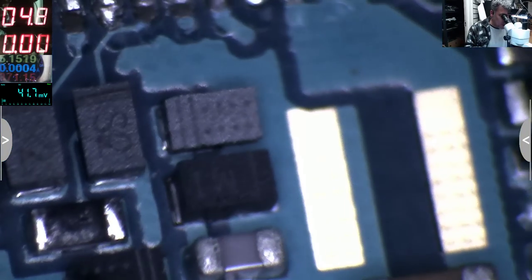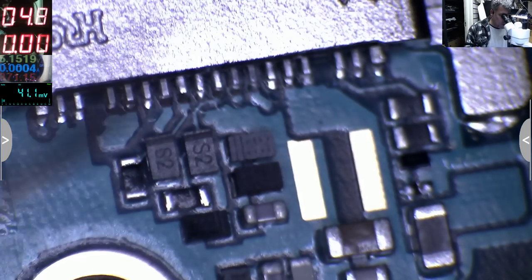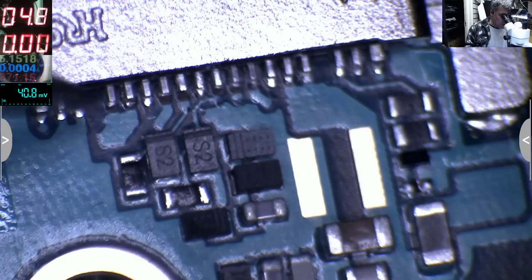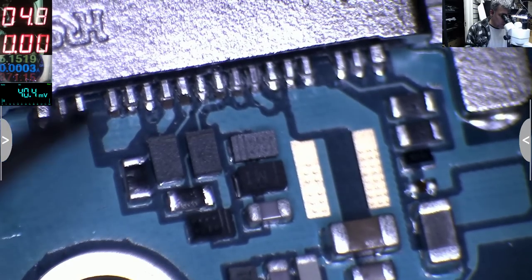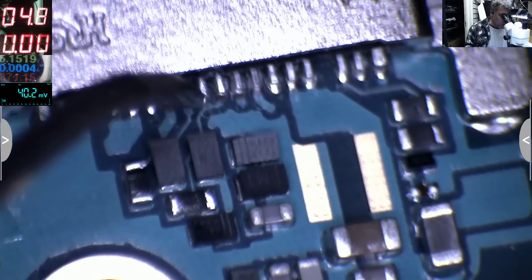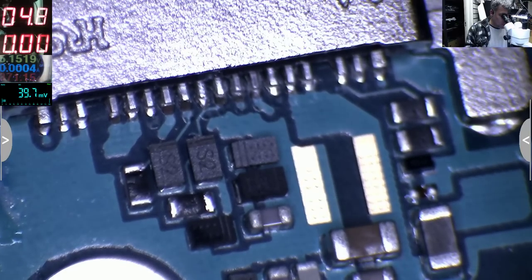No, you don't need all these pins. You have the plus. You can see the power rails here. Let me bring this into focus, yeah. This is plus, I think, because it's on the mirror, yeah? And this is ground, and also here should be ground. So you can see here is ground because it's on the big track, and this is plus, I'm sure. And the data pins are somewhere here. Maybe this and this, because you have two diodes. Yeah, probably.